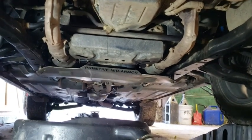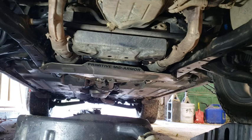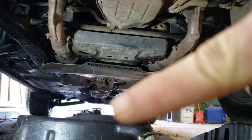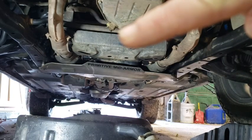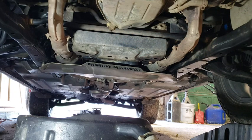It's almost down to a drip — still a steady stream, just barely. I wanted this shot so you can see the jack is already in place. I'm going to go back and jack up the rear diff, and I wanted a good shot of the Fumoto valve at the same time. It's almost to a drip; it'll go on and on — I only ever stop draining once it's to a drip.